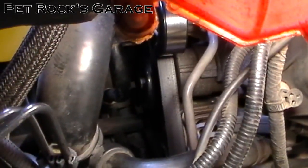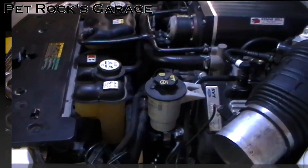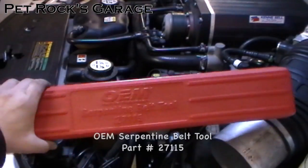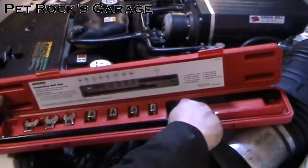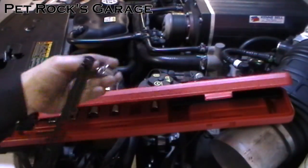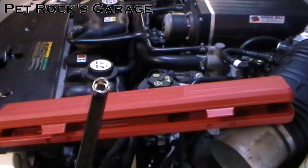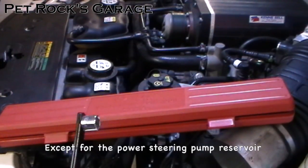There's not very much room down in here so it's a little bit hard to film — that's pretty much the best shot of that adjuster bolt I can get. There's not very much room to get a wrench in there, but there is a tool you can rent from your local auto parts store: a serpentine belt tool kit. It comes with a really thin bar, some sockets, a couple of crow's feet, and a quarter inch extension. This plus the 15mm socket barely fits in the area needed to relieve the tension without having to undo a whole bunch of other stuff to get clearance.